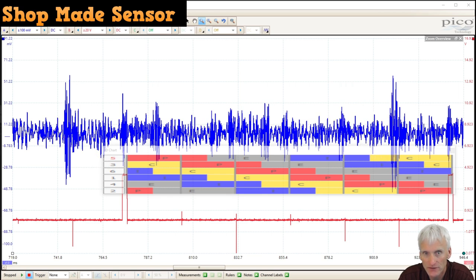Hopefully it's just a valve adjustment, which these Hondas actually do have, because of their VTEC system, they have adjustable rocker arms so you can set valve lash. So that's a quick way to determine, is it a valve issue and what cylinder it is.